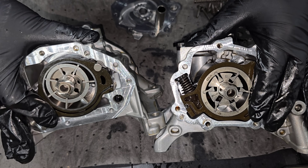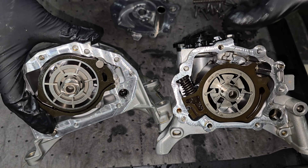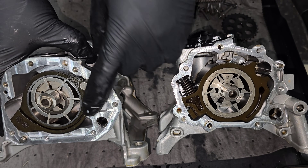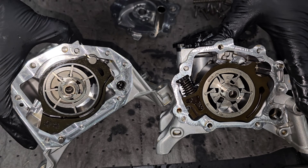It kind of is what it is. I think this more clearly illustrates the difference between a Gen 1 oil pump and a Gen 2 oil pump, and what could potentially cause these Gen 2 pumps to fail and the plastic to crack. I really wanted to see it for myself outside of just technical guides. I haven't really heard of oil pump problems on Gen 1 B58s — it's definitely nowhere near as rampant an issue as it's becoming on Gen 2 B58s. The easiest way to know is to measure your oil level, monitor your oil pressure, and see if it starts getting higher than it should.